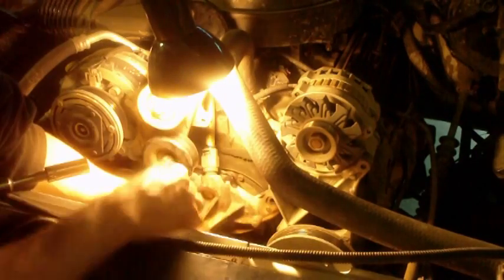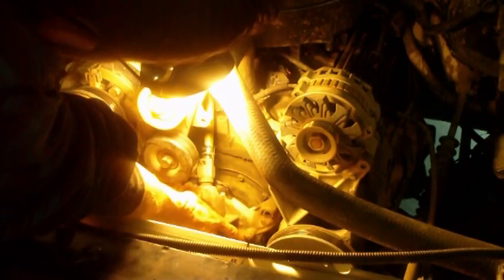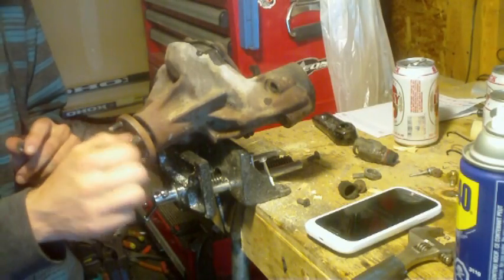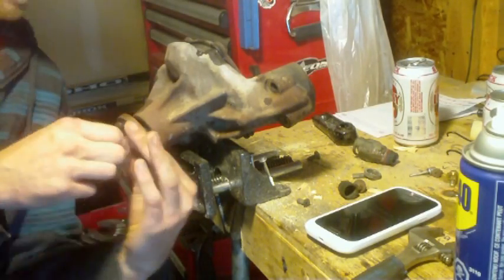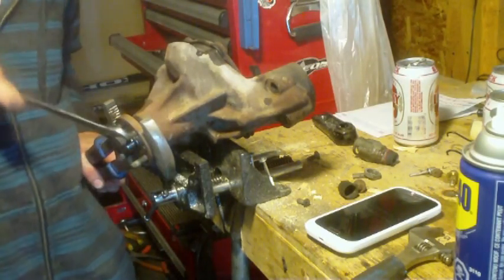I got it. Essentially, it's two clips. You just push the bolt in on the top and it should come out. You just kind of shake it lightly and take it out. Put two nuts on a stud and tighten them together so you can use the bottom nut to undo the stud from the flange. You should just play.